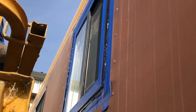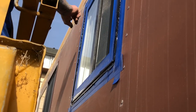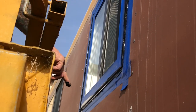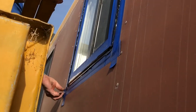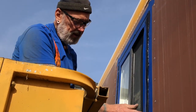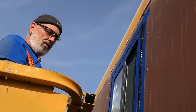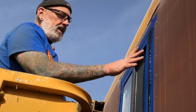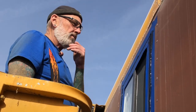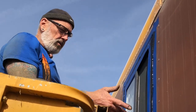He's just smearing this around, getting it down inside the cracks. We put in foam backer rod to fill the back of the crack so it doesn't take so much caulk, and also because the caulk won't dry when it's that thick. We're using silicone on top of the backer rod to fill the gap and seal to the bus body, which has a flashing on it, and up to the window. So no water can get in, and we're mounted from the inside to the tubing frame we put on there.